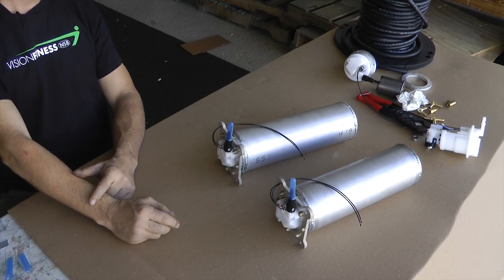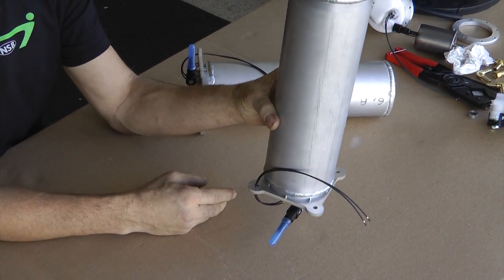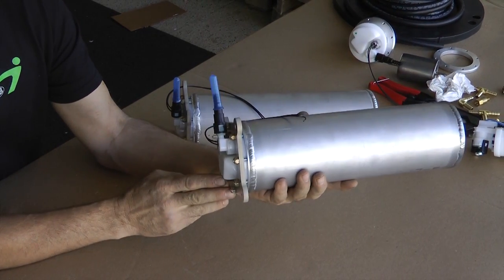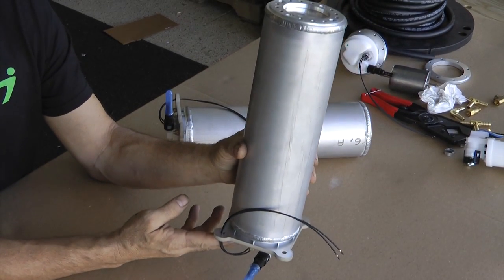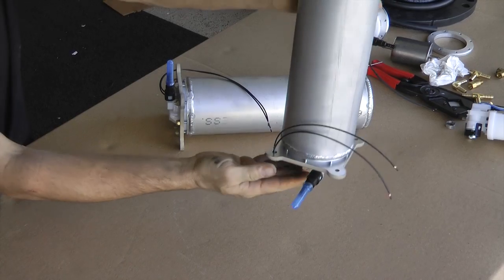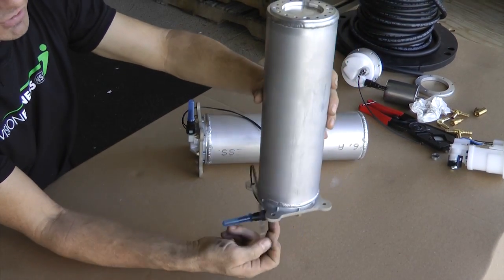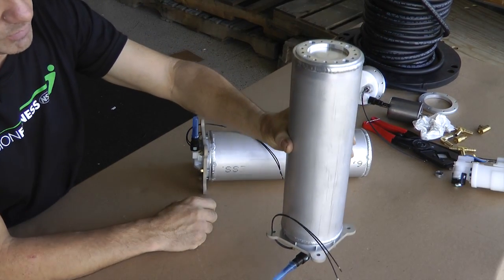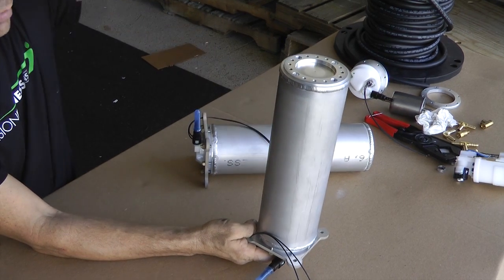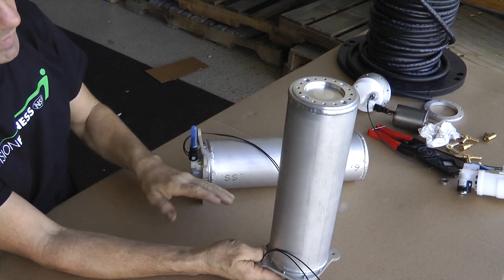Here's a way to do this: take these small pumps and install them — as we have done here at Viking — in these small header tanks. They're 0.6 gallons each. Someone mentioned they'd like the header tanks to also serve as a fuel reserve. In a Zenith there's plenty of room above, and these are easy to install behind the baggage compartment. They could be made twice as tall — with a two-foot tank you could have up to about three gallons if you had two of them.